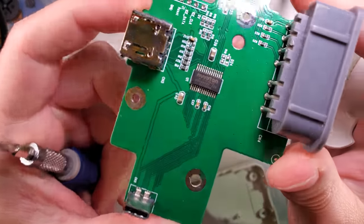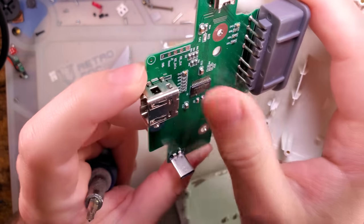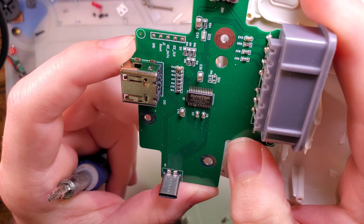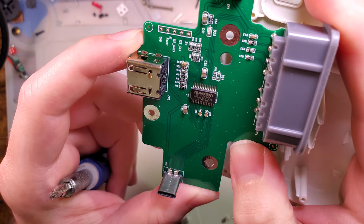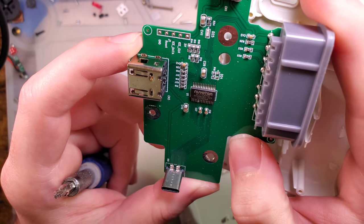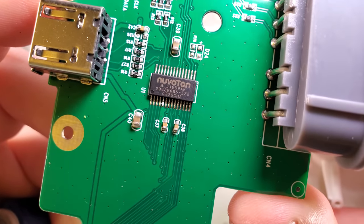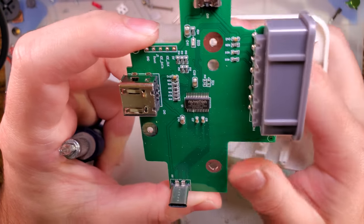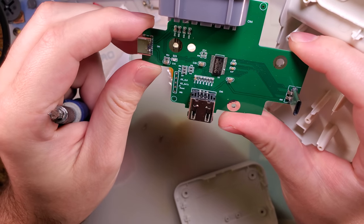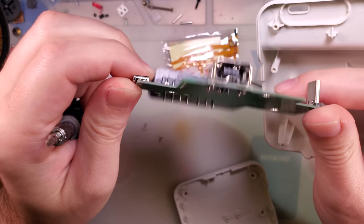That just comes right out. We've got a Nuvoton microcontroller ML51EB9AE, next line 2948B085-ZZ2, last line 037GCHA. Hope that helps — or you just look at the screenshot because that comes out really well on the video. Nothing special. Looks like we just have a few terminals here for programming the FPGA, for programming the microcontroller, and then literally just enough to make the microcontroller work, and that's it.